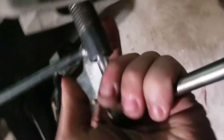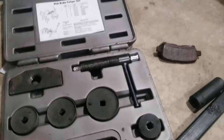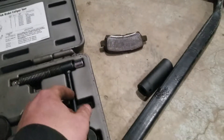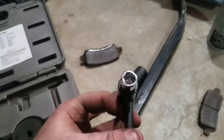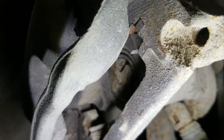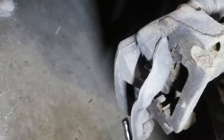You can see I've got this piece in here already. This kit right here is a disc brake caliper tool. This is to turn the caliper in, which you have to do in this case. You can see it just by looking at them — it's got the little notches in there. You can see the notches in the caliper right there. You've got to find one of these that fits in there, and I believe this one does.